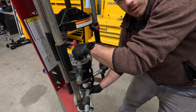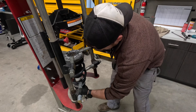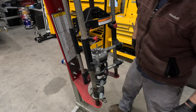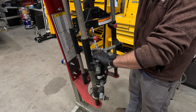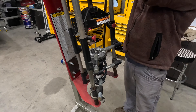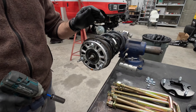As you can see, this is a stamped steel piece and there's a snap ring right here. We're going to take the taper on the inside and go over the top so it sits nicely, then reinstall our plastic isolator so we don't have noise.